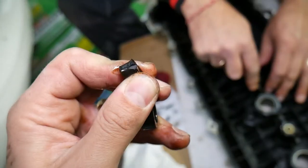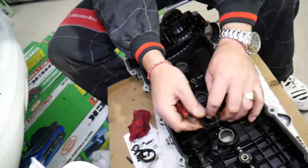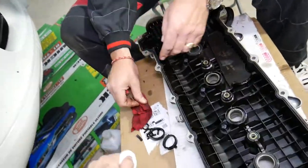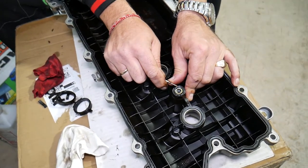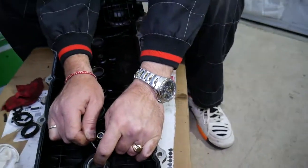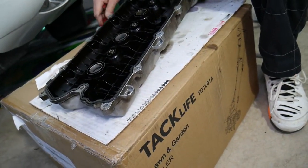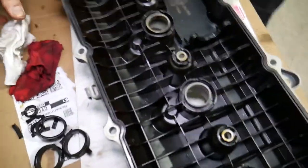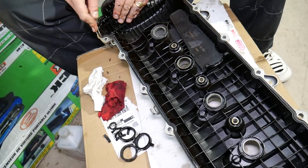It just cracks — pretty bad. We'll do that to the rest and show you how to remove the ring. You can see how it came out in pieces. We have some silicone right here that needs to be cleaned, and later we'll reapply some as well. That's where the timing cover meets the cylinder head — apply a little bit of silicone gasket maker right there.